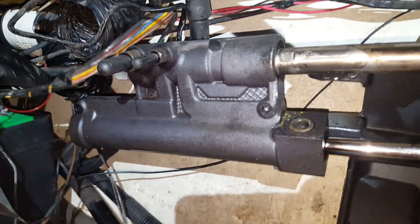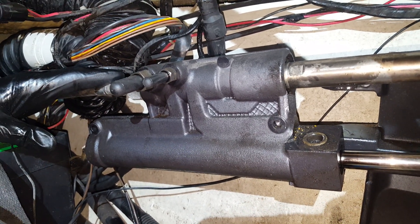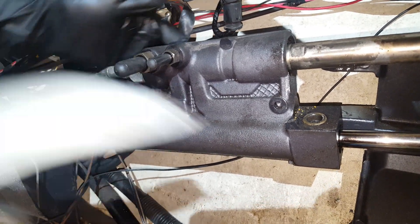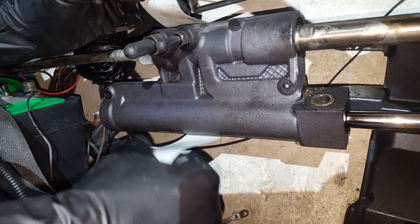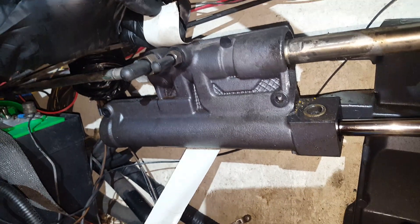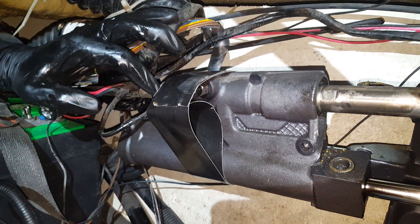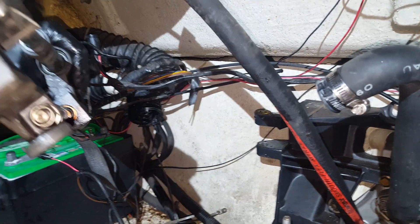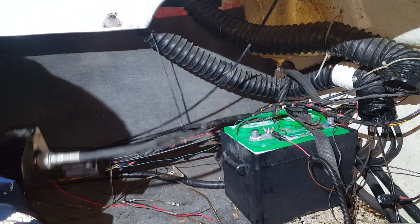The last thing I'm going to do before I get this steering pump actuator out of the way — I put little rubber caps in the openings to keep garbage from flying in. I'm going to take a piece of duct tape and wrap it around to keep it protected. Now I'm going to pull it out of the way — and away it goes, just like that.